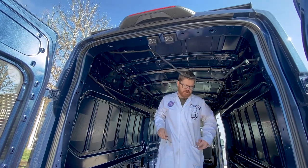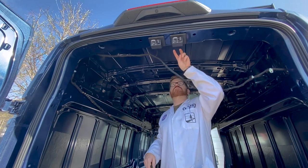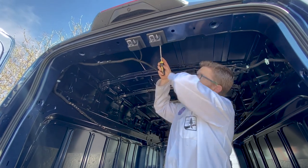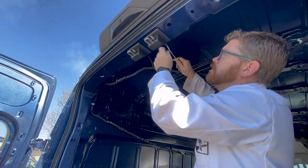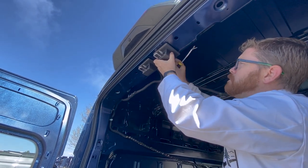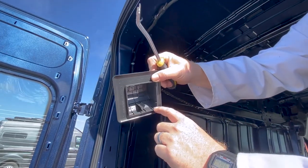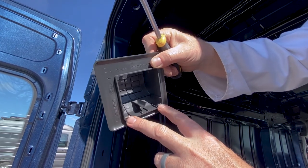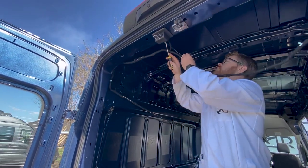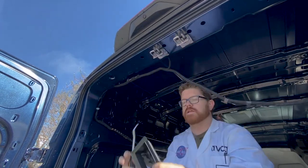Now to take these rear door catches, there is a bit of a trick — they are fragile, so you do want to go a little slower and be mindful. There are two little pins that hold the back in that are really easy to break, and it's a pain to put them back on if they're broken. We just want to slide our panel popper tool at the back of this latch and give it a gentle pressure to pop it down. Once it's down it just slides right off the back. These little tabs are the pieces that will break off if you're not careful.